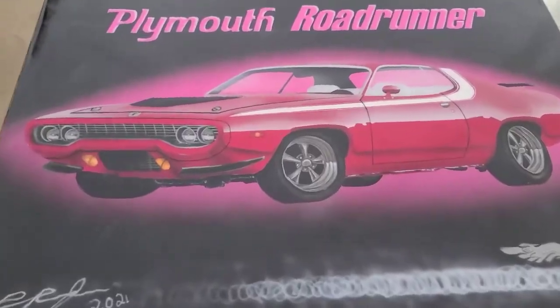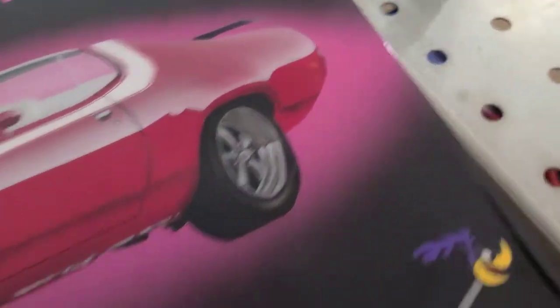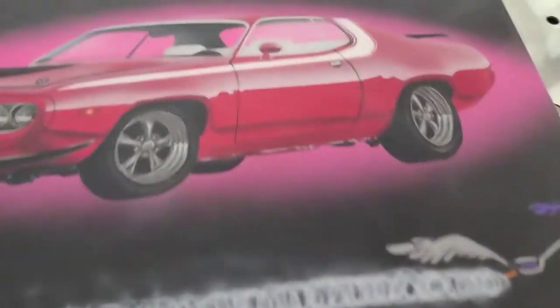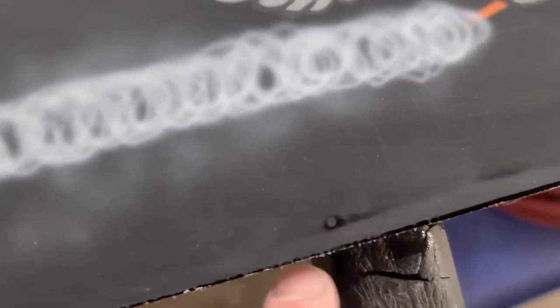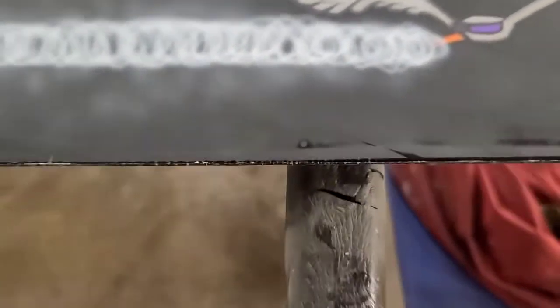So I went in here and sanded with 1000 grit. If you can see up in here, this is where there were a couple of dust nibs — they've been sanded out. When I'm talking about sanding out a dust nib, there's a part I left down here. See how that dust nib is still showing on the corners? When you sand that fully out, like the one I had up here, your panel is going to look like that. Just keep sanding until you get those flat.